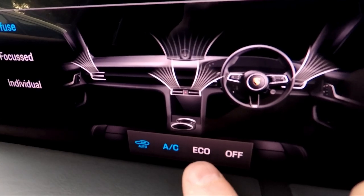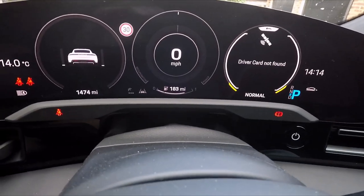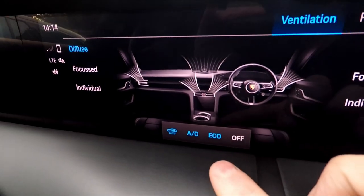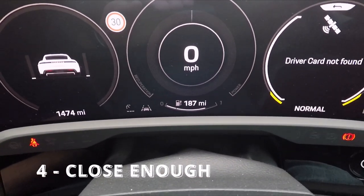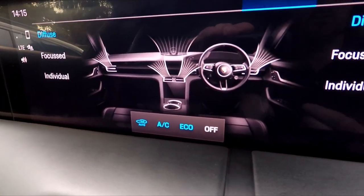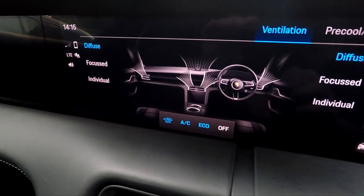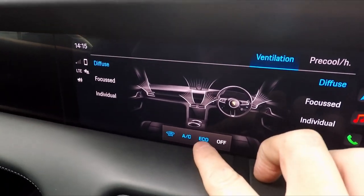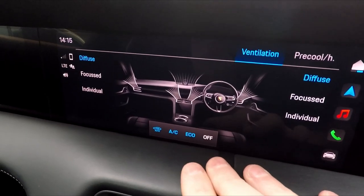But there is also an eco mode here. We're at 183 miles there on the range — it's gone down even more actually. The eco mode will disengage the air conditioning ventilation for the back if there's no one sat in it, and it will also only run the compressor intermittently, so it tries to save you a bit of energy. The manual doesn't go into any specific detail about what it's doing, but I've done a bit of research and it's compressor-related as far as I understand, and also reducing the cooling for the additional passengers. So that is one way you can run everything and try to save a little bit of energy, because the Taycan is already pretty low on range.